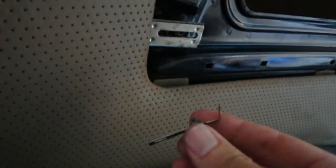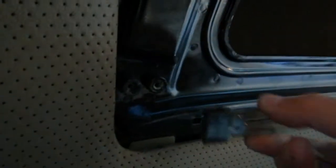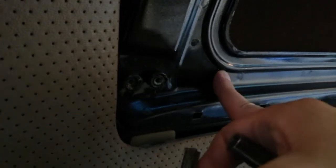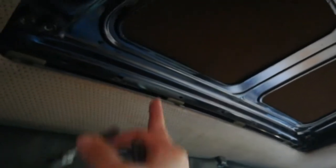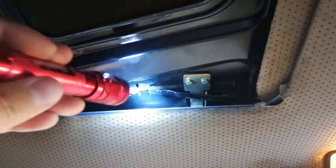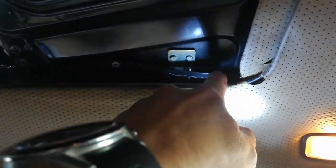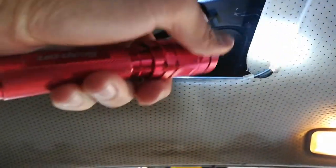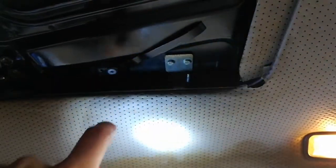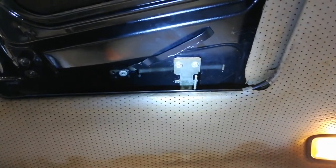When you take these two bolts out, a thin sheet metal clip comes out. After removing both clips at the front corners, come back to the rear corners and pull off this spring — it's a big leaf spring of sorts. Then remove the two bolts at the rear corners and do the same on the other side. The panel should lift off now. Note: you'll need a small 7mm box wrench here because a wire end is in the way of using a socket.